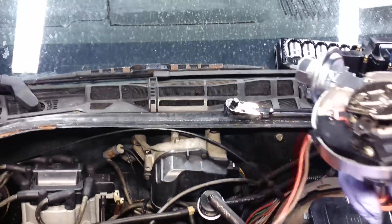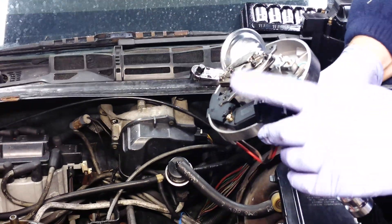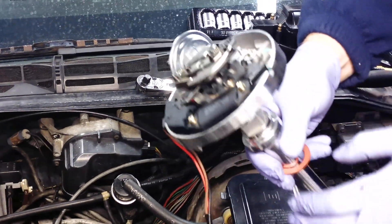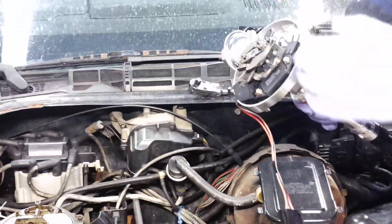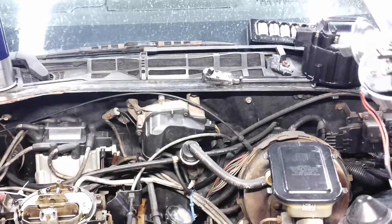Like I mentioned, this harness comes with your HEI — it just goes in the back of that cap assembly. It feeds the coil and sends a signal from the pickup coil to the module. And that's how it works, just single wire. So tune in again for the next video in the series where we're going to be putting it in and, like I said, upgrading the carburetor. Have a great day, guys.